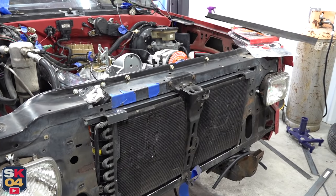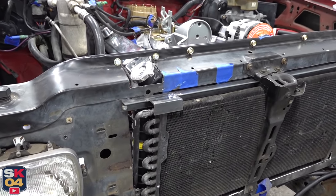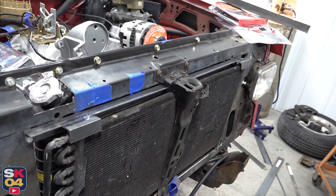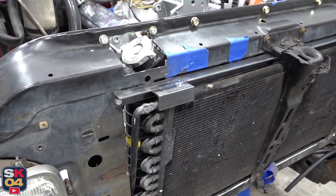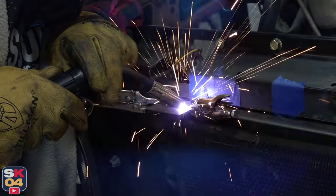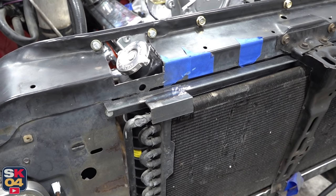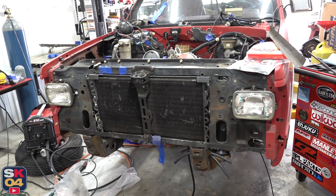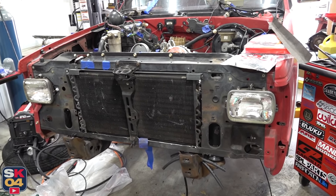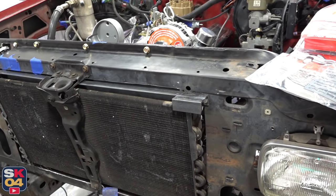Since we're up here, I'll go ahead and show you what I did for the condenser. At the very top, to hold it in at the back, I have a piece of angle iron spanning the entire opening of the core support. I also welded in these little tabs so it can be held at the front too, but I left plenty of room so I could still be able to get a nice insulator in there so we don't have metal on metal rubbing together. I am by no means a fabricator and I still have a lot to learn when it comes to welding, but I am really happy with these little brackets — especially what I had to do on the back side, which I'll show you in just a moment.